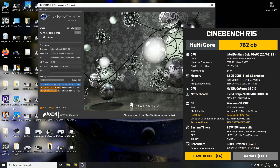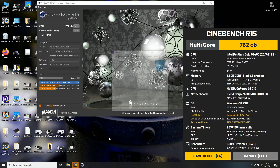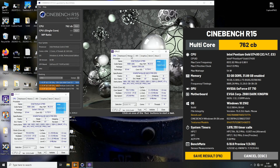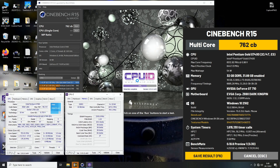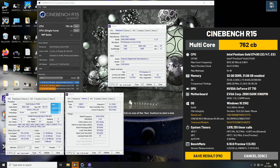These new BIOS work very well for maximum multi-core — you need the latest BIOS with mode 3. FLL override seems to work better on the newer BIOS, but the thing that needs to be fixed is command rate 1, which currently doesn't work properly. On this BIOS it just fails at the 3A debug code.